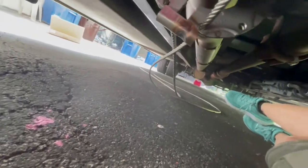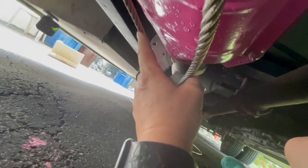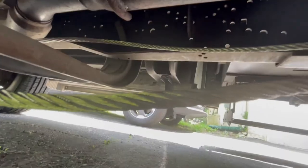Life will be much easier if you uncurl all the rope first and lay it out. I also highly recommend moving it out of the sun while you're putting the clamps on. Notice my clamps are on super loose right now — that's important so you can feed the cable through. They're just finger-tightened, and after I run the rope back and forth I'll tighten it down. Right now I'm laying right next to the drivetrain, so I want to make sure I keep the cable far away from that — route it on pieces of frame, nothing that's going to move.